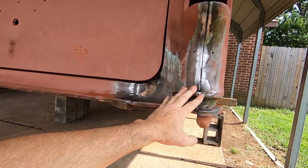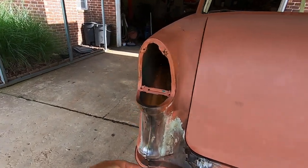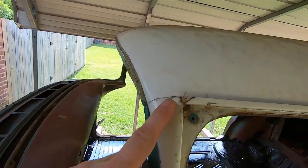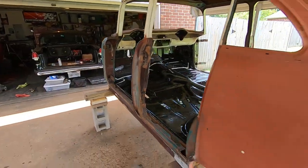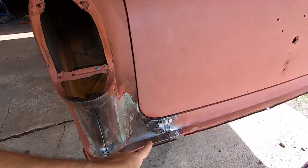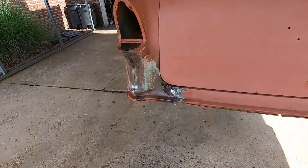Lead tends to crack, and over time you'll notice little tiny bubbles here and there if your lead's ever been exposed. I can show you right here — there's a crack in a lead seam right there. On my hardtop, I got rid of all the lead seams. It's all butt-welded sheet metal through here, up here, and back here. I cut all the flanges out, built a piece and formed it to fit in there, and then it's all butt welded and smoothed out.